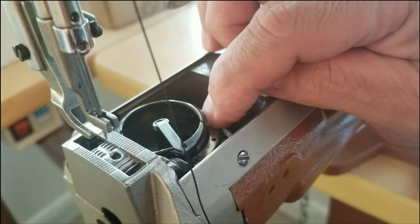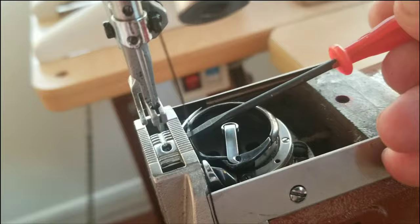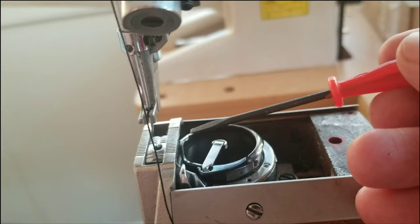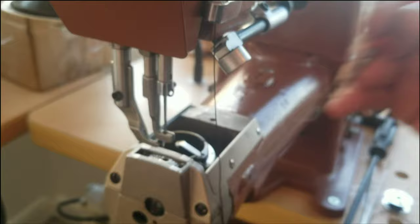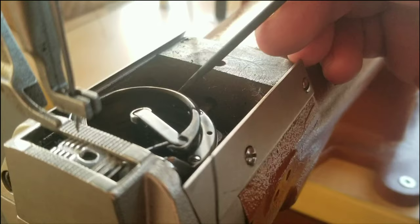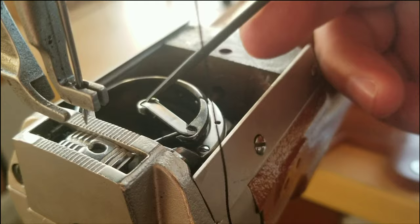The case itself has a little tab — let me point at it with the screwdriver. It's located right here and it has to engage a little notch that's right underneath the throat plate. The bobbin case is held in place by this little semi-circular part called the gib. There are three little screws — one, two, and three. We have to remove those screws and pull the bobbin case out.